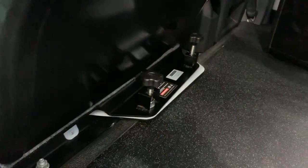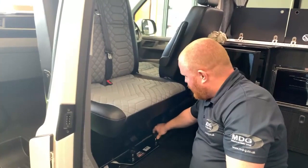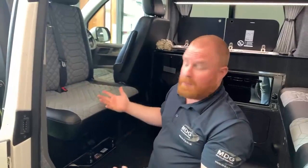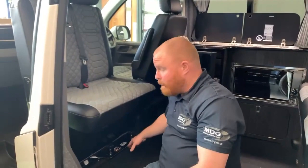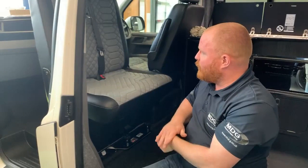That means you can screw it in without it cross-threading. Don't tighten this one all the way — use it as a pivot point to line up the one on the other side. Loosen off, drop the bolt, make sure there's no tension, and then screw in. Once comfortably finger tight, that is now the seat in the camping position — it's facing the other way, so you've got the living space at your disposal. In this position you only need the front two bolts secure; you don't need the two at the rear of the seat, as you're not supposed to drive with this in place.